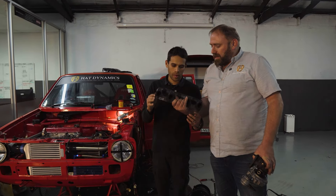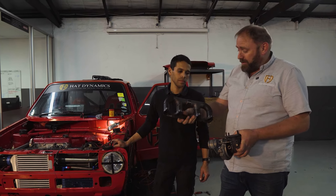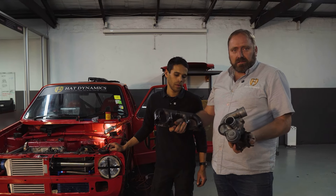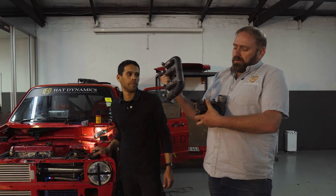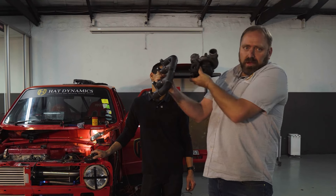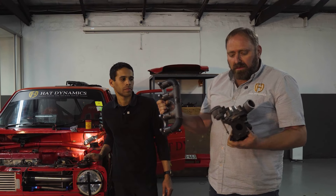This is the manifold going into the engine. The reason it's so long is because the intake runners on an MP9 manifold are quite long — it looks a bit odd here, but it'll look good on the car. This is just a mock-up for the turbocharger. We're putting a small diesel turbocharger on it so that it'll boost really early. We're not aiming for a lot of power. We've got to decide what angle we want it, where we want it, then weld everything together. The turbo will go away for refurbishment and then we fit it in.